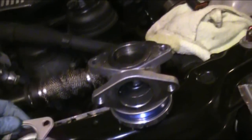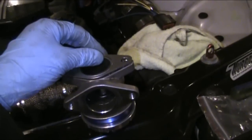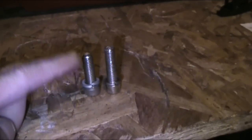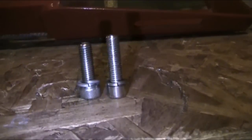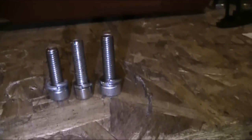The fire ring goes in, then the gasket, and she'll tighten down just like that. I was going to use this bolt to mount the wastegate but it's a little bit too short to add a nut on top for extra security. Don't worry, we're still not going to use those cheapo ones - I went out and got more good stainless steel bolts, even a little bit longer so we'll get some more thread bite with nuts on top. So with the mixture of a good quality bolt, a locking washer, and a nut on top with threadlocker, we should be good to go.